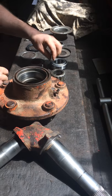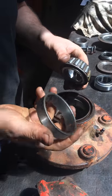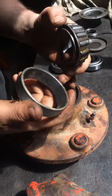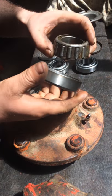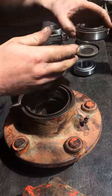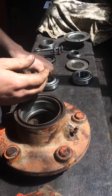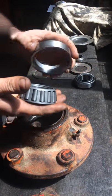First I'll show you what's happened with one of the wheel bearings. If we take a close look here, we'll see that it's had water damage — you can clearly see the pits in the rollers and in the race. This will eventually fail and obviously cause problems, so I'm going to replace that wheel bearing with a new one.